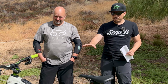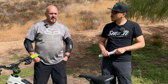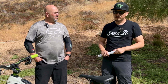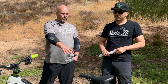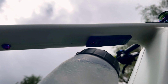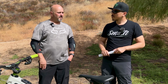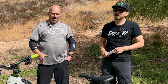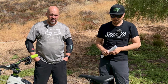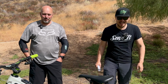Have you had any frame or motor issues so far with the Crestline? I've talked to a buddy of mine who's in good with them, and he said as of right now they have had zero defects with the frames or the swing arms. The only issue I've had with this bike is the bottom controller. There's one screw that holds it in, almost like a rivet nut that goes up into the carbon. It pulled out. Simple fix. I used some JB Weld epoxy and put it back up in there. That was on their advice. Nice. But yeah, that's the only problem I've had. The fit and finish on these bikes is great. Everything just fits. All the bolt holes are perfect. I can't say enough good things. The perfect bike, almost. Pretty much, yeah.